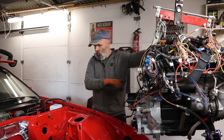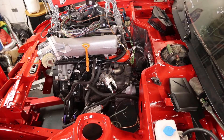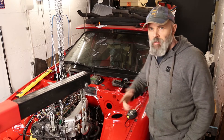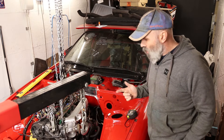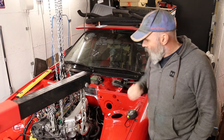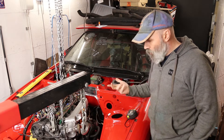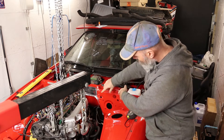The engine is just going to be wheeled over here. I was thinking I was being really clever - just get the hoist over, shift a few things around, and slide the old engine in. That's not worked at all. It's been at least a week since that last bit. I've had real problems getting the engine levelled in. Being on the hoist has really helped, but the last couple of days I've probably spent two or three hours just trying to get everything lined up and bolted between the engine and the torque tube.